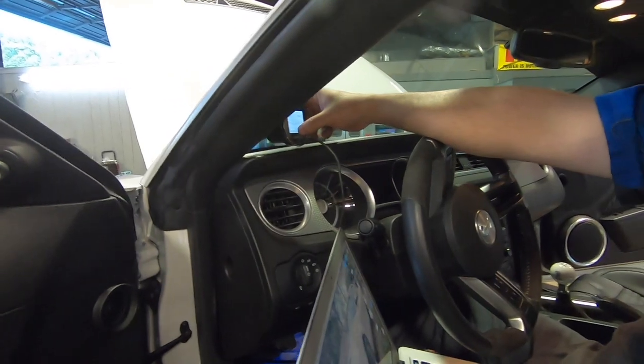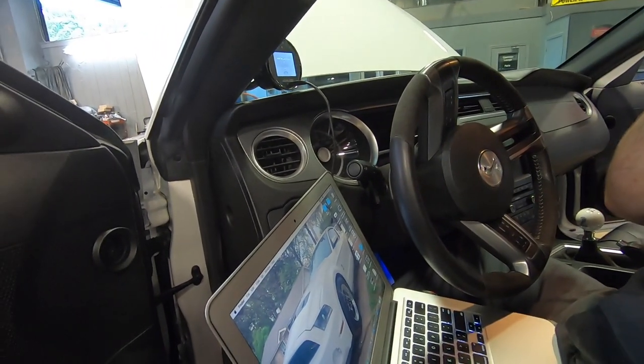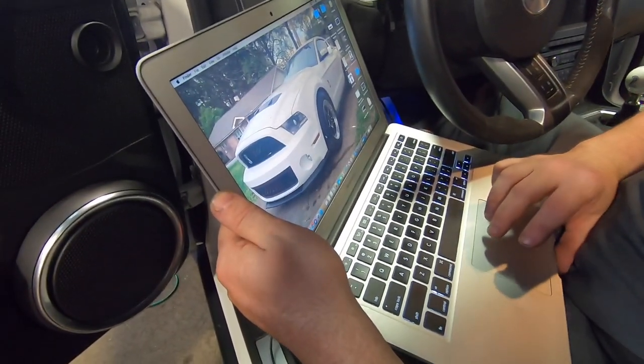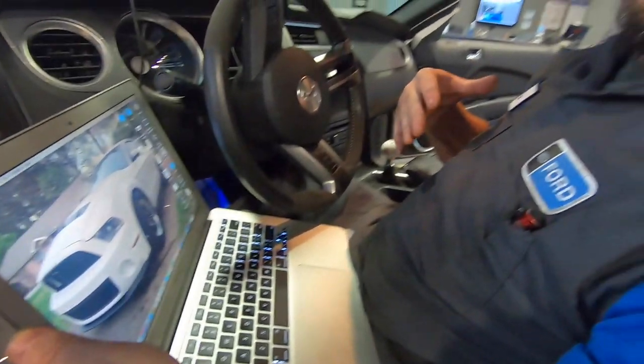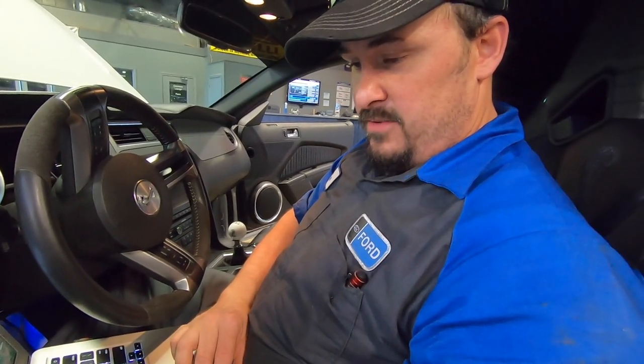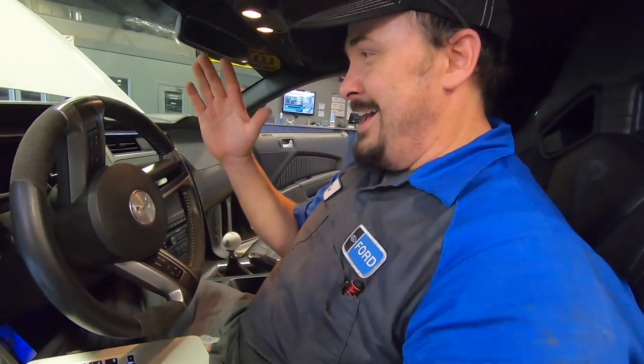Dude. All right, so guys, what we're gonna do now is hook back up. I just did a data log, and basically what Daryl wanted was idle for 5 seconds, 1,000 RPM, 1,500 RPM, 2,000 RPM, 2,500, all the way up, so he could watch everything and make sure everything looks good. So that's what we're about to send him, and then he will tell me what he wants me to do next. He might send a revision, but yeah, it's a little unnerving setting the rev in your car up in increments of 5 seconds.